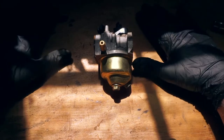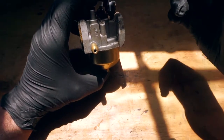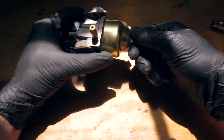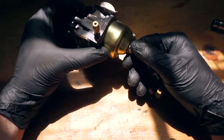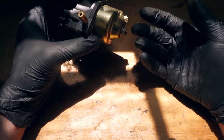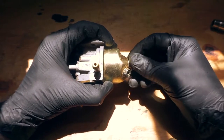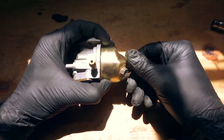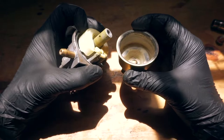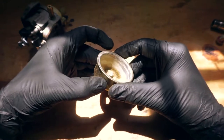A little change of scenery — I'm here on the bench now with the carburetor off the engine. I put some gloves on as well. I loosened off this nut here but haven't actually opened up the carburetor yet. When I took this nut off, gas didn't come pouring out, so I'm assuming there's no gas inside. Going to go ahead and unscrew this bowl nut — that's just a 10 millimeter — and pull the bottom bowl off.